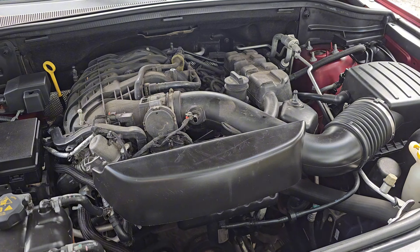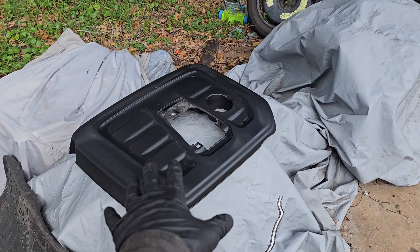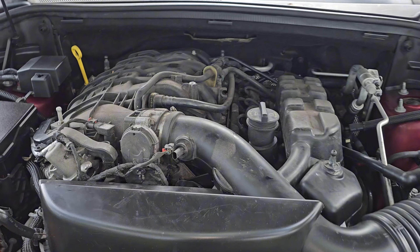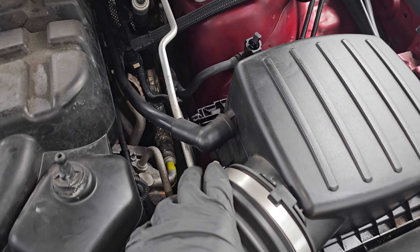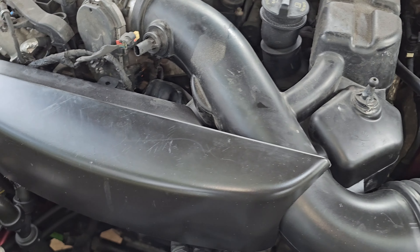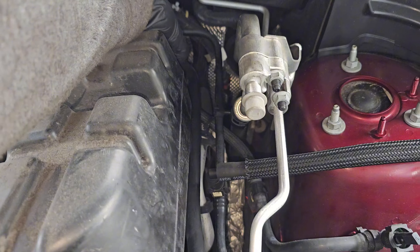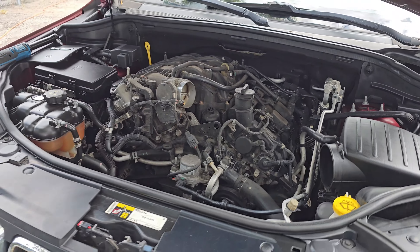This one is a 2017 so it has the EGR setup on here. First, come here and take the engine cover off — there is a 10 millimeter bolt holding that one. Then disconnect the air intake temperature sensor. You have an 8 millimeter clamp here and another 8 millimeter clamp here. Undo those, then pry up from here — there is another lock point. Lift up and we can place the air intake to the side for now.